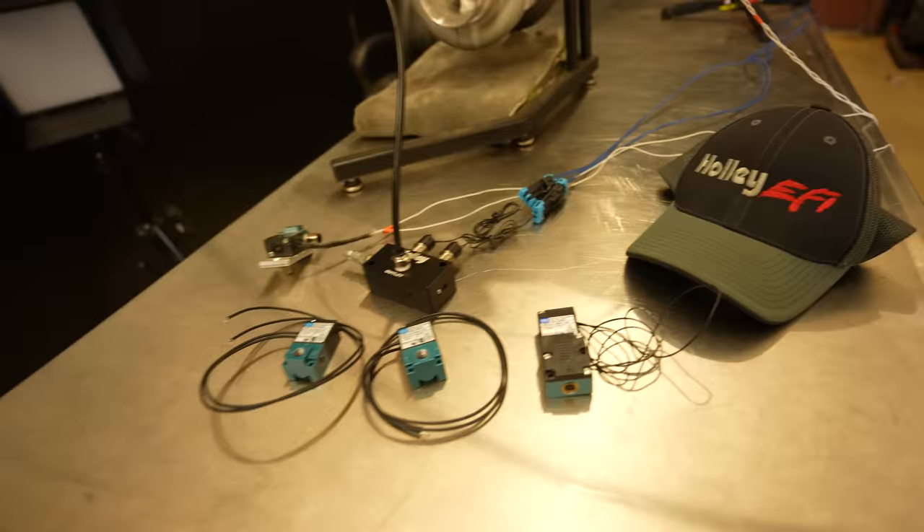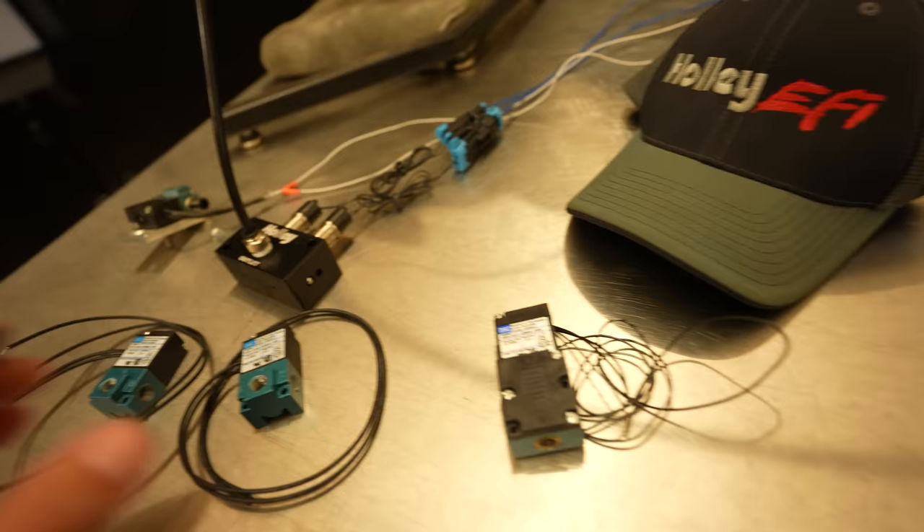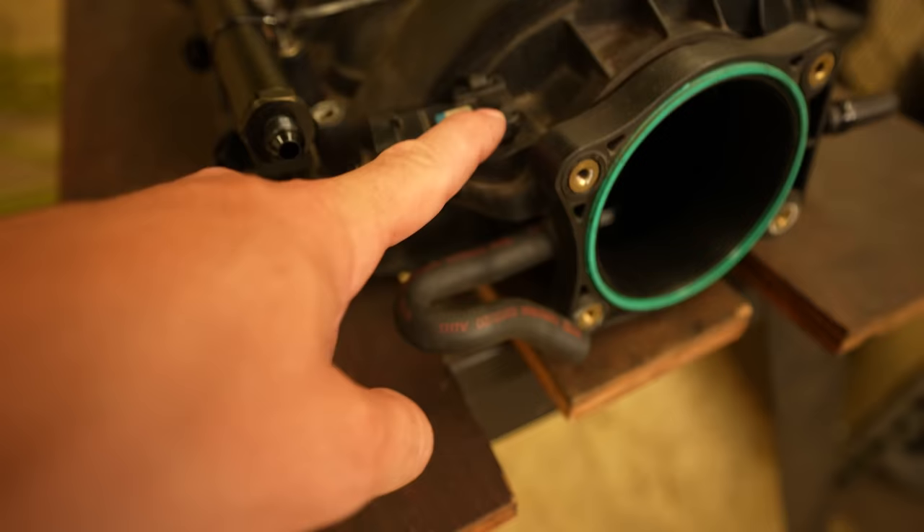As far as fueling goes, I'm 99% sure this just has a Corvette-style filter on it, so for the time being it will be okay - but once we put some turbos on here it won't. I'm kind of torn on whether to mount an external regulator and do a traditional return-style fuel system now, or just wait and do that while I'm doing all the turbo stuff. Truthfully, the hardest part of all of this, other than getting to that stupid grommet, is that this stuff is all kind of boring - building the turbo kit is a thousand times more fun. Trying to not just start ripping it apart and building a turbo kit right now is tough. But I need this to run naturally aspirated because I need to make a bunch of videos for my Holley training course - that's the primary purpose of this car. Speaking of the course, I've got a lot of boost control stuff set up: single three-port, single four-port, dual three-port, and the high-flow valves. We'll go through all of that individually.